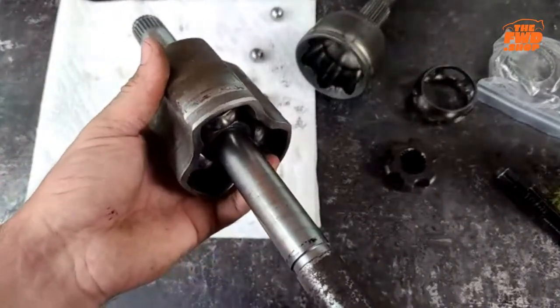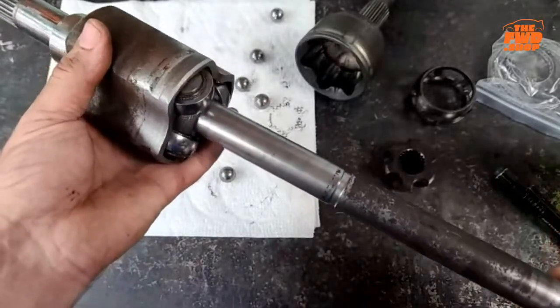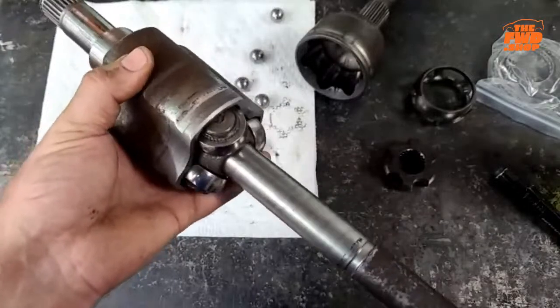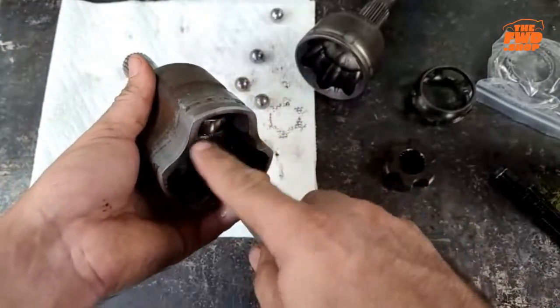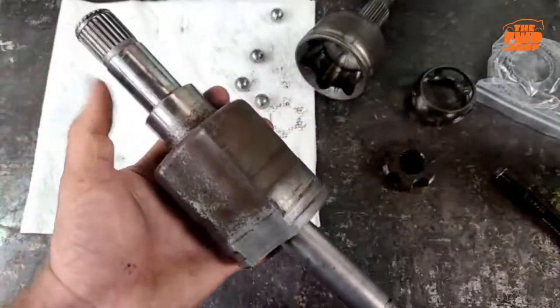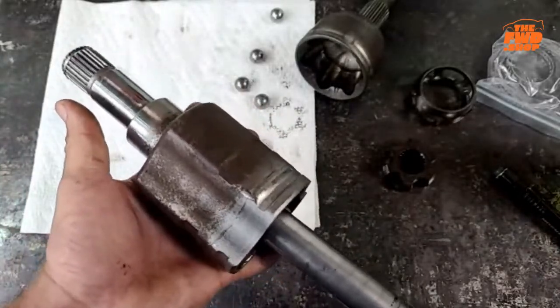That's why if you have an axle that's too short, or if you have too much camber that's pulling this axle, if you have these trunnions out here, it's easy to pop these apart and have issues if they're at the end. It's also why some guys will weld a piece across here to hold those in. If you do that, your other end is held tight.